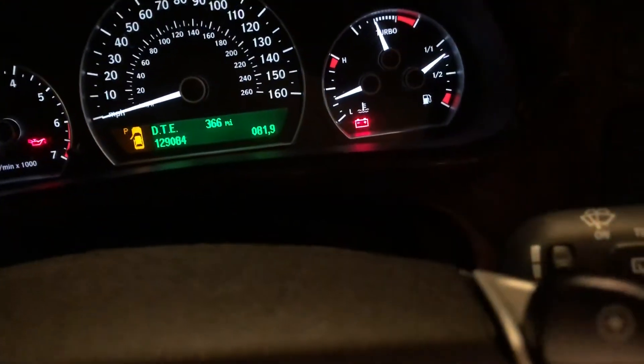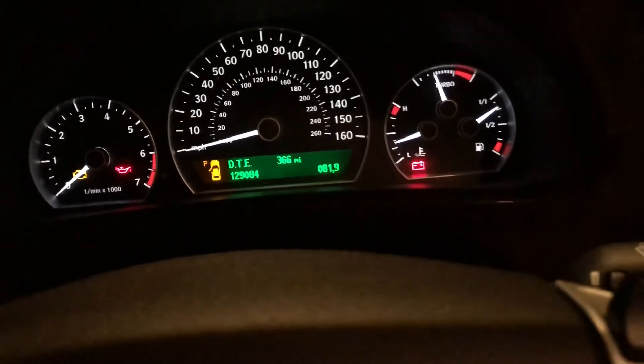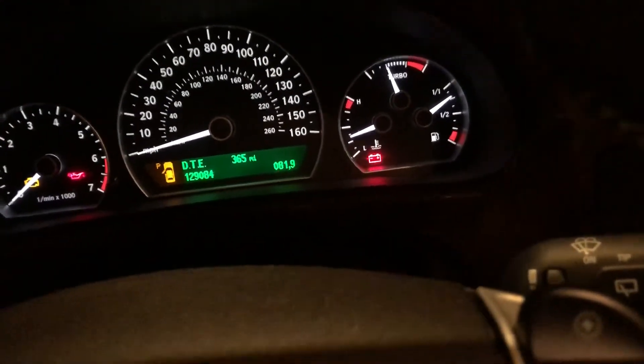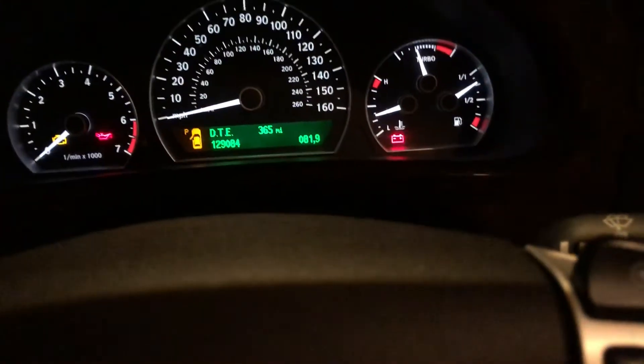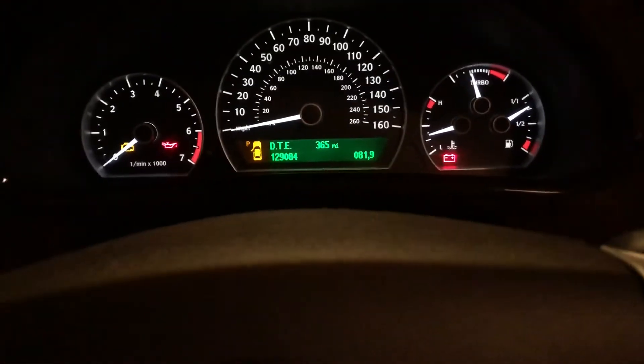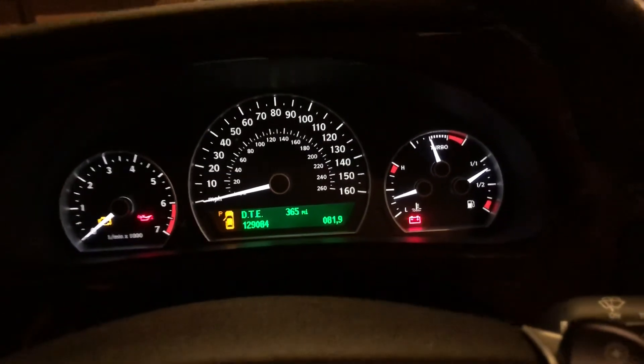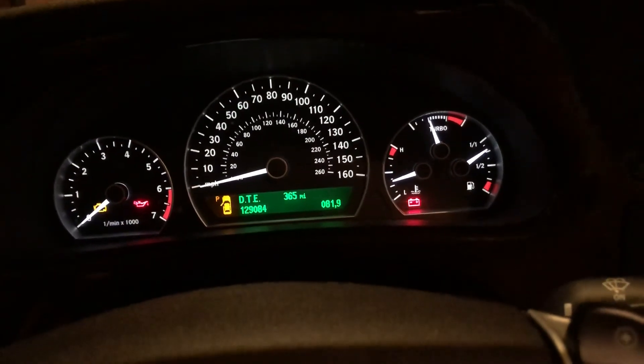What that does is it raises the idle speed when the car is in drive. I'm not going to start my car right now because my garage is closed, but basically it's going to raise the RPM at idle by 50. For me, that greatly reduced the engine vibration I was having — I could feel vibration in the steering wheel and even in the door just touching it. It's not gone with this setting, but it's definitely reduced — probably 50% to 60% — so it's significantly better and tolerable. I hope this helps if you've been dealing with vibration and chasing that issue.